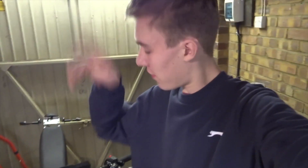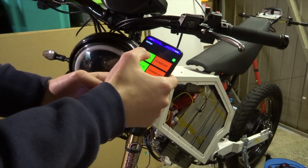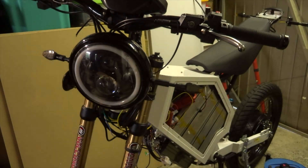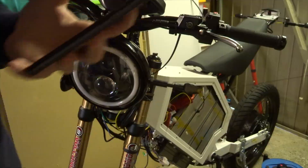Just to show you that things aren't always rosy when building an e-bike - I built it up in my workshop and it worked absolutely fine on my power supply. However, now I'm connecting to the bike I'm getting an issue: the black and blue wires go onto the Sabvoton which is connected to the battery - connected straight to the BMS. If I go into the app and make sure it's turned on, you'll see it comes on and then turns straight back off again, giving an error saying 'abnormal start'.